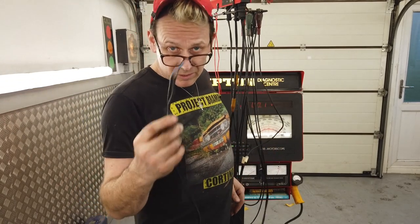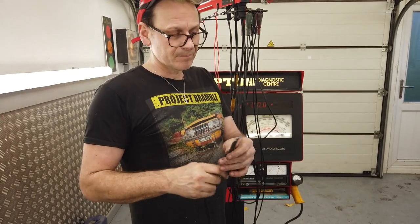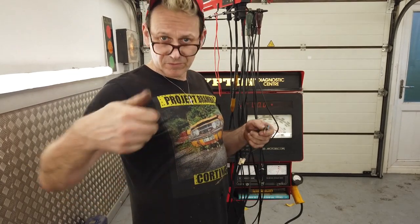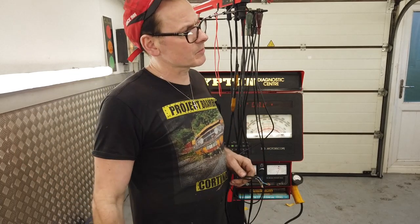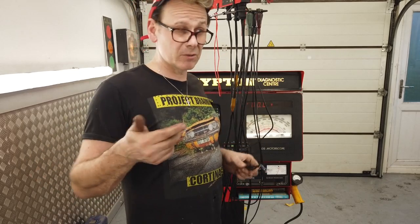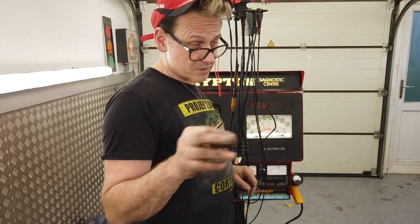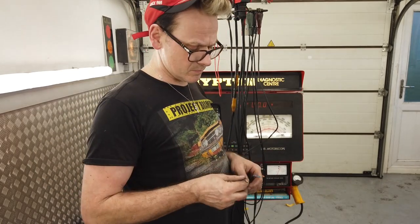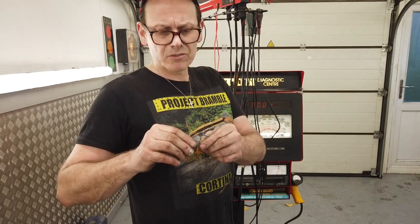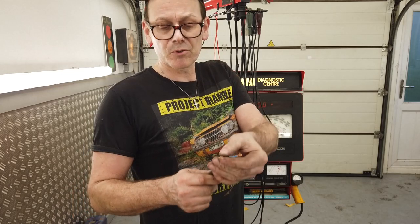So I don't want to solder croc clips to the end of this lead because it would be effectively no use. We need to put a multi-plug on it, and then you can have an adapter on the multi-plug with slim line connectors. We're going to have to come up with something which will slide onto a post of a coil, but grip it. Now you could have, say, a ring eyelet, but it'd have to be a really good fit and a different size ring eyelet because one post is slightly larger diameter. Or you could solder these right in a hook loop and push them on.